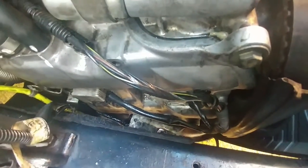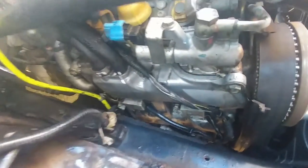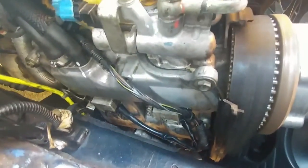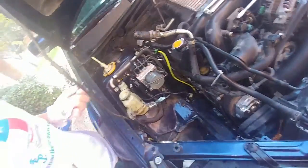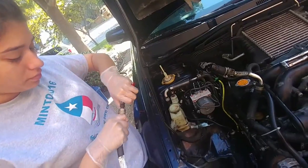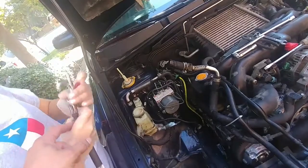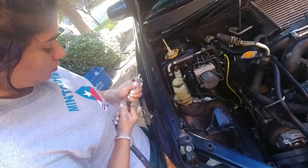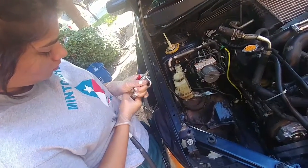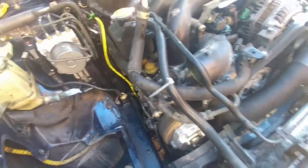The big test is whether we're going to have to lift the engine - something I'm not real clear about because I keep hearing different things. Take the dog bone out, the motor mounts out. Right now we're going to put some compressed air in there and try to get as much gunk out as possible. Pull the sleeve back and then pop it in, then blow as much stuff out of there as possible.